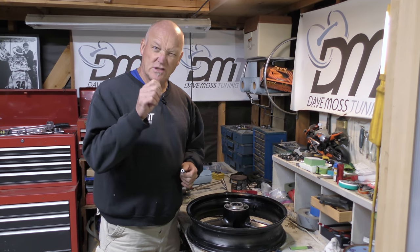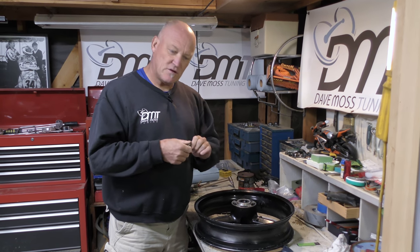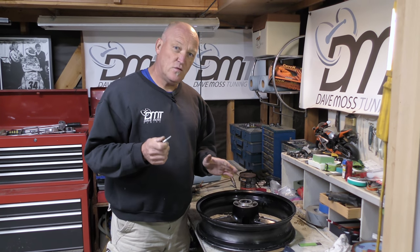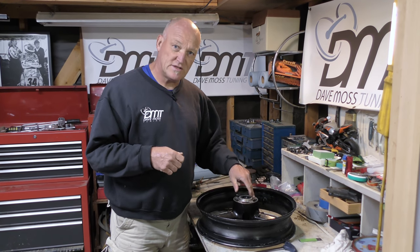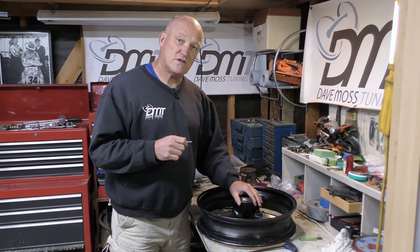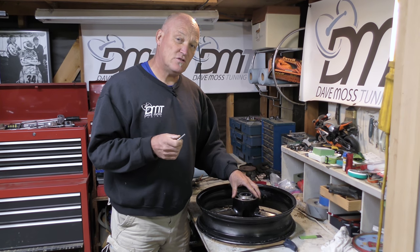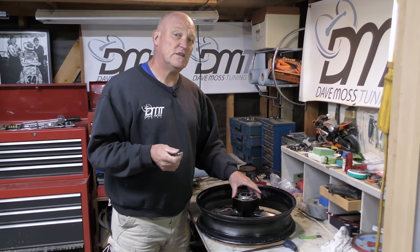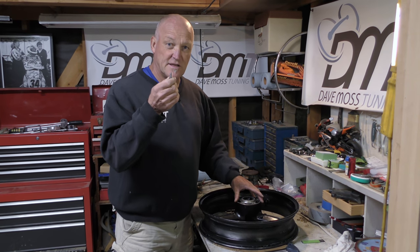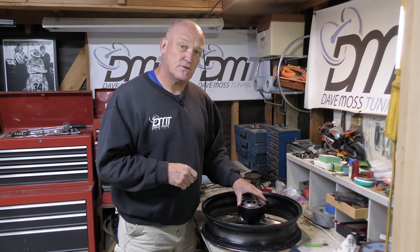With a tap, you use a little bit of grease on it. With these, you can do the same. Just a very slight coating of grease and that will pick up any residual. Either way, when you're done, use compressed air to blow each of the holes out so you've got as much of the old Loctite out as possible. And if you did use grease on the tap, as much of the grease out as is possible too, so that when we Loctite these in, we're guaranteeing there's a very clean surface to adhere to.